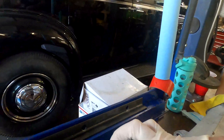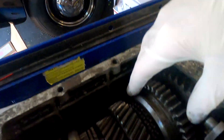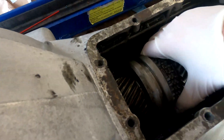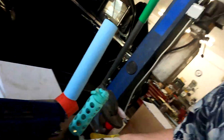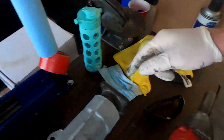Not knowing a ton about transmissions, but having some recent experience with the DeLorean transmission, my gut tells me that there is a lot of lateral play in here that seems incorrect. We're going to have to do some measuring. We can't quite see the shaft on the bottom, so there might be something really obvious going on once we pull the top shaft out and then see what's going on down below. One-to-one seems to be fine, but engaging any of the other forward gears, or reverse for that matter, is not turning the output shaft. So let's get into it.